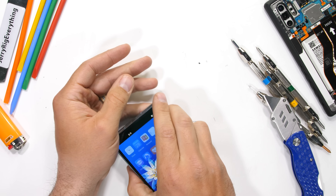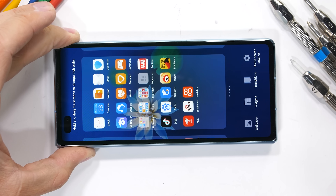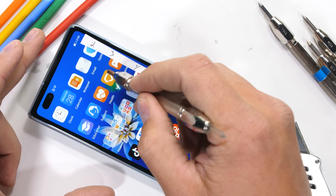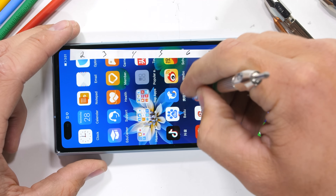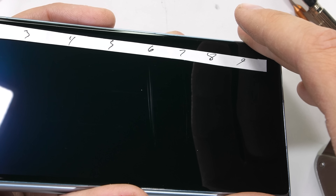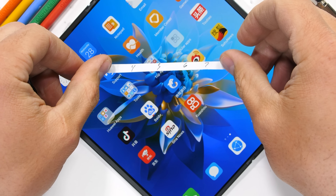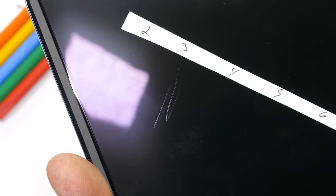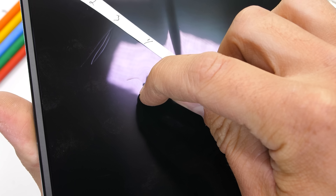Huawei has given us a removable plastic screen protector on the front display — very nice of them. With the Mohs scratch test, a plastic screen starts scratching at level 2 or 3, a glass screen at level 5 or 6, and a sapphire screen at level 8 or 9. From the scratches at level 6 with deeper grooves at level 7, the front display on the X2 is made from tempered glass — it can use glass since it's not doing any bending. The larger inner display, however, does a lot of bending, and we start seeing marks at level 2 with deeper grooves at level 3 since it's so soft. My level 3 pick is pretty much just cutting into the plastic, and my fingernail can leave marks on the surface of the inner screen.